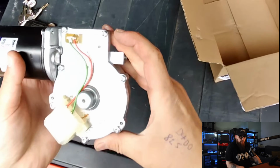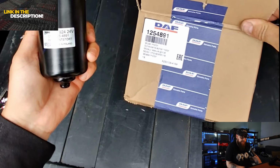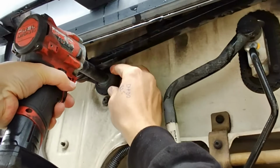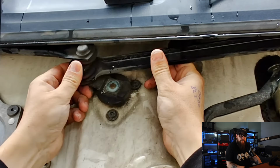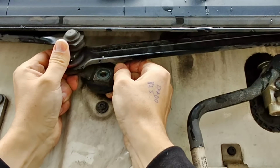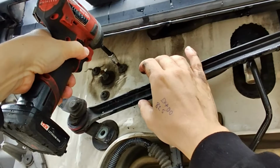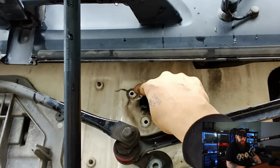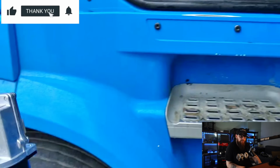So a new one was purchased from DAF, which is actually a Valeo unit. I'll leave the part number in the description for future reference. So now to get the linkage off. Some brute force and ignorance later, and I got the wiper linkage loose from the spindle. Some nice cracks here from the bolt holes. This is the sort of issue where you'd want to submit a field report to DAF for product improvements.